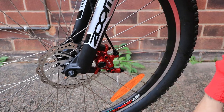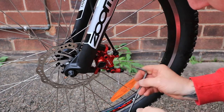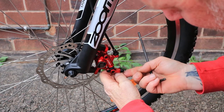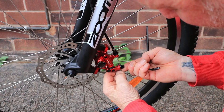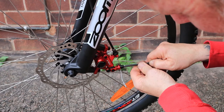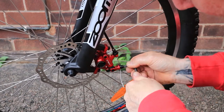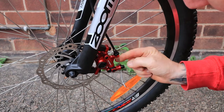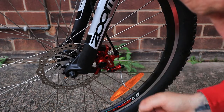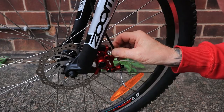I've just been checking and there's one minor thing I've done wrong — I just wanted to show you this. When I did this clamp up I pulled the cable down but I didn't push this up. You have to push this up and then lock it off — that makes a big difference because I hadn't got any brake whatsoever. So now that should work. I did want to make the point that you have to push the plunger up first before you nip up the thread, and then you can do fine adjustments with that.